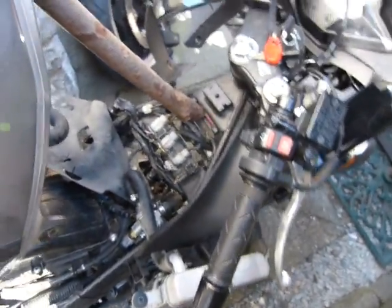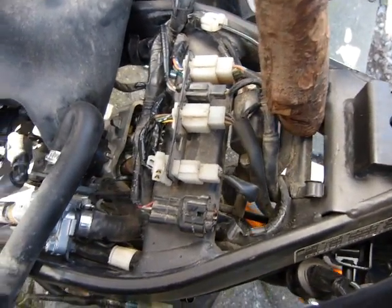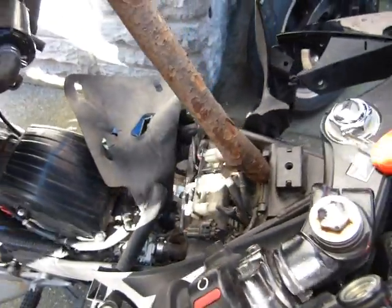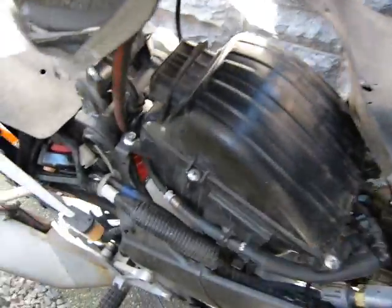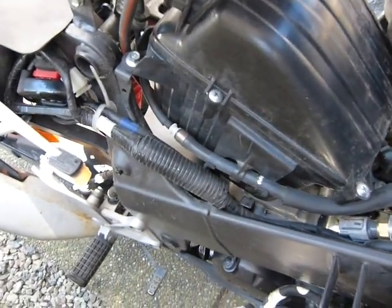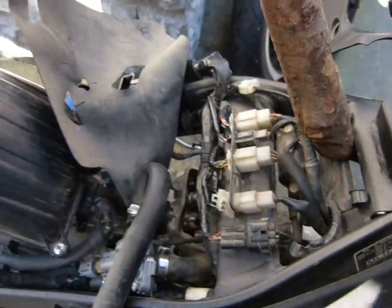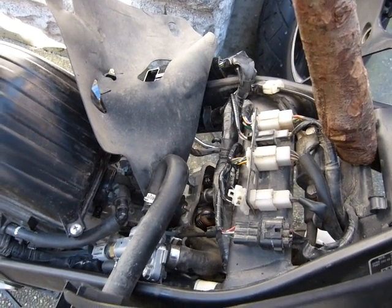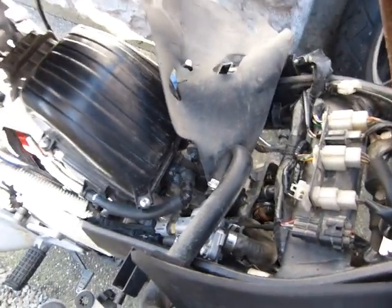You can see body panels missing everywhere, and no, you can't do the valve job from up here, because you have a welded-in cross brace there, on which this stylish wooden stick is also resting holding up the tank. The air filter lives there but that's just a non-interest item. This rubber flap was covering these electrical connectors there — so that would be the extent of this valve adjustment job.